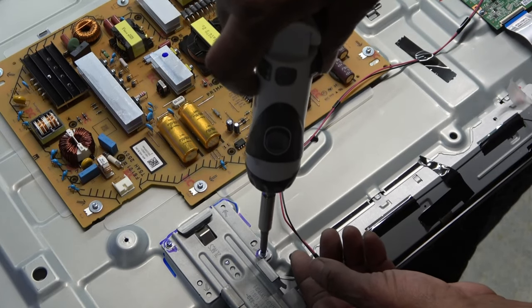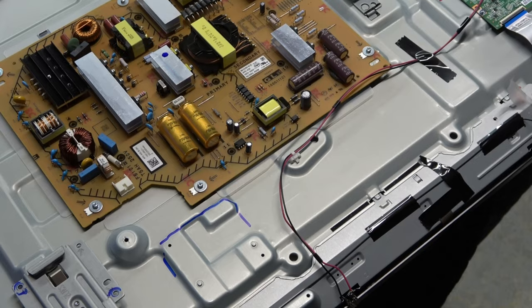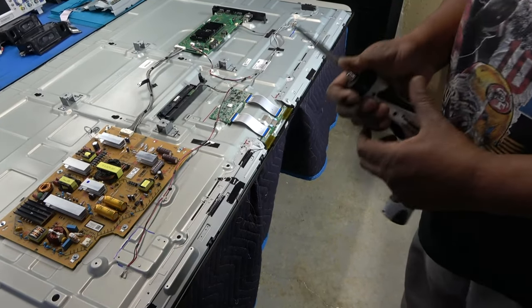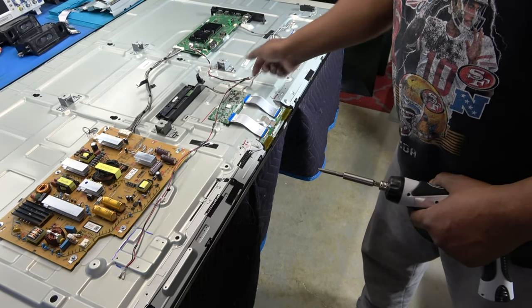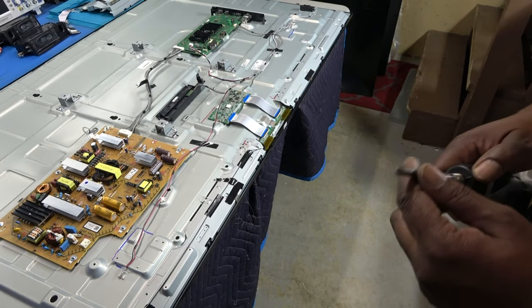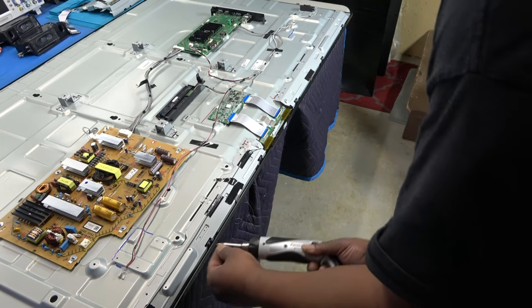We are reassembling the TV. Comes right off. Okay. Do the same thing with the one on the other side. Okay, since we have to pull the screen out, obviously, to get to the LEDs, what we're gonna do is disconnect the driver board from the T-Con board. All right. And these brackets have to come off. You can see our driver boards are underneath these two brackets, and they're number one Phillips. There's three screws on each side up under the bottom, so I'm gonna take those out.